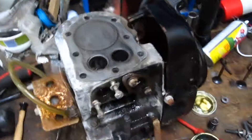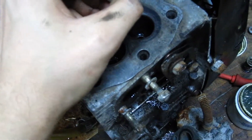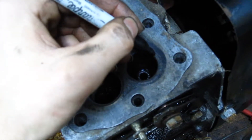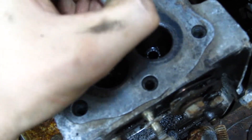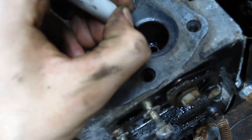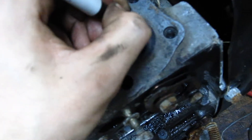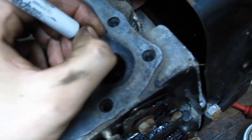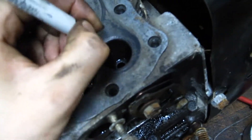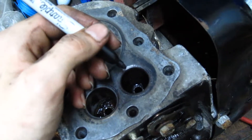So this is the marker trick. What you can do is take a permanent marker and almost paint or mark just the outside meeting area of where the valve actually meets up with the valve seat. The whole point of this is so you know where you've actually lapped the valve and where you haven't. All the black spots show where the valve hasn't been lapped yet, and all the clear spots show where the valve has been lapped.